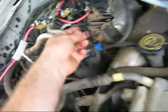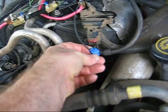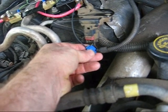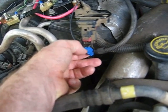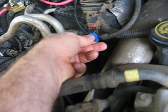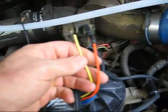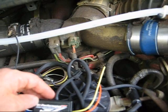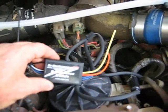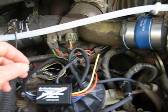This black wire comes over here to the MAP sensor — you have to tap into the middle green wire. This is on a 2001 F-350. They give you a tap to use; I used a different one, but it worked okay. I might have to take that back out and fix it. It's got some extra wires on it. This thing does not modify your built-in computer chip — everything else is just the way it used to be; this just sort of overrides it.